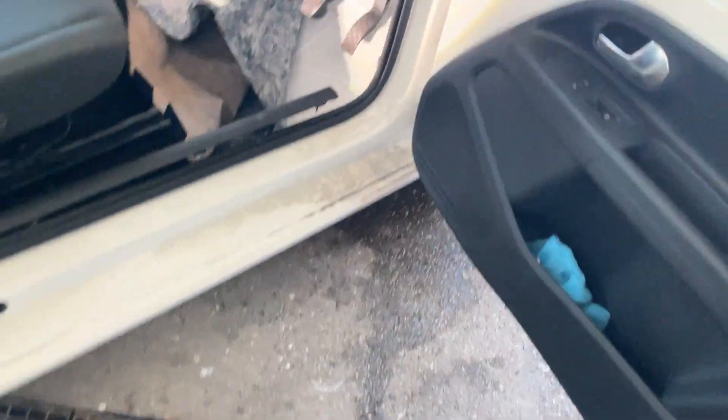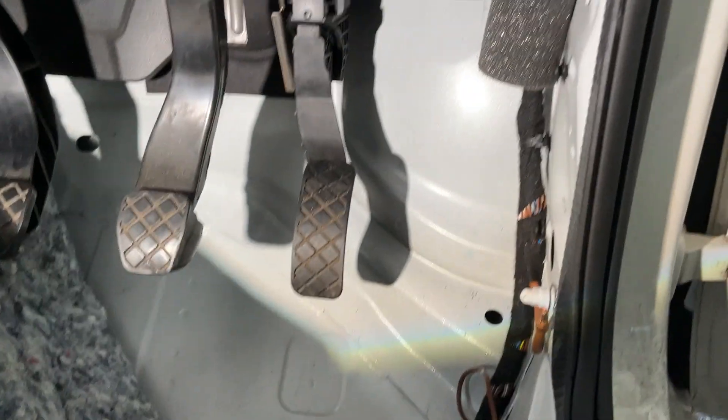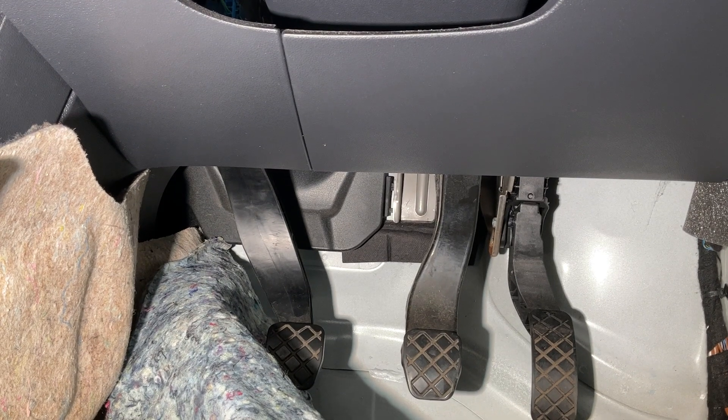If we now go into the inside of the car, it's full up to the level — it should now reveal where the water is coming from. The only problem is we do have a box section here, so it could possibly be travelling down through the box section and then coming in.